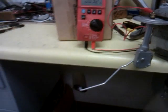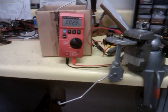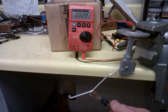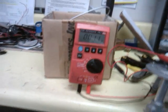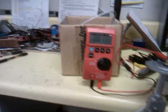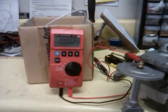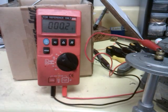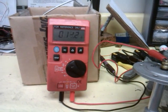Since this is the outer one, anytime you go below about a half tank, this thing sits on the bottom of the tank and will sit here on the lower stop and rattle around. Anytime it goes above about 46 or 47 ohms, if there's any jump above that, it will fault out.